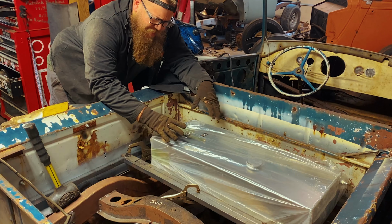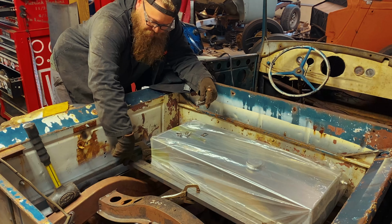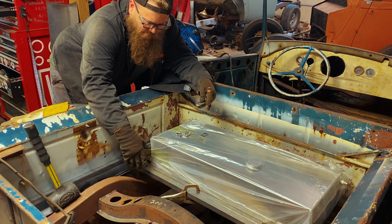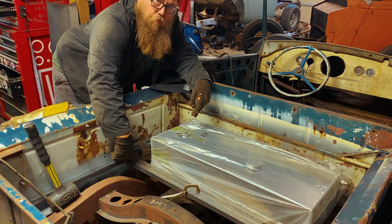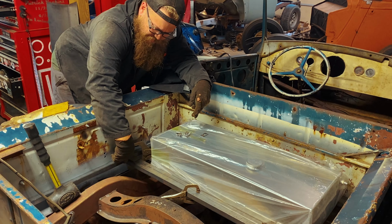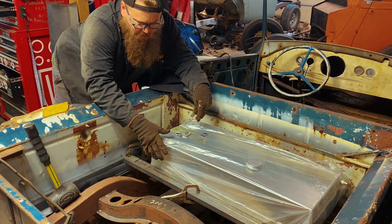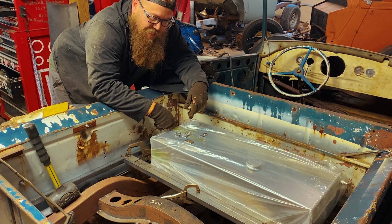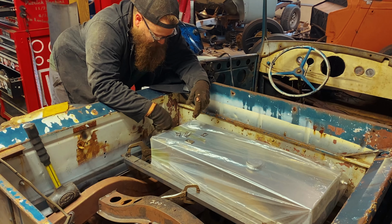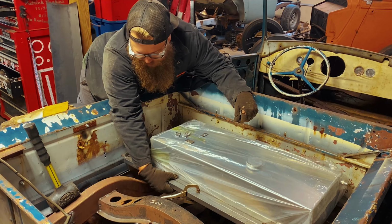The way that I'm gonna be able to get the tank in and out of the truck is I'm about to weld these tabs on here to this 2x1 here, and it's gonna bolt into this 1x1 right here. So I'll weld a nut inside that, and it'll bolt right to that. Really simple, gas tank will be able to come in and out, which hopefully I don't have to take it out other than for paint. So that's why I need to make it removable. It'll just bolt up right here like that.